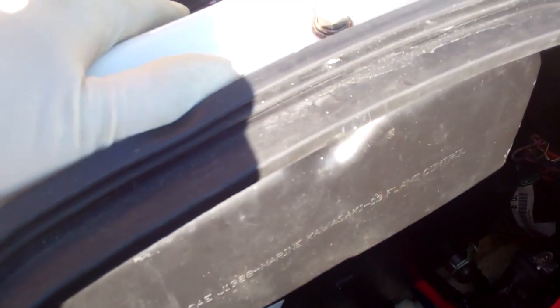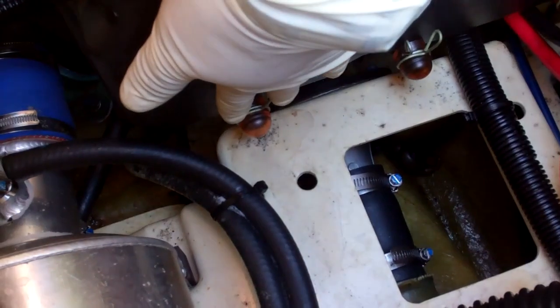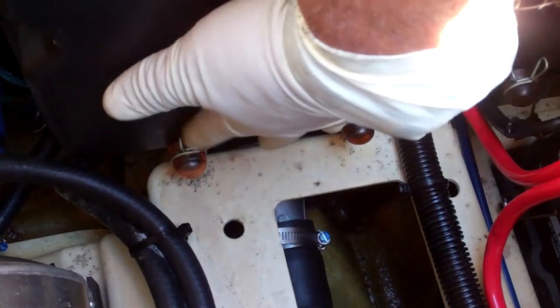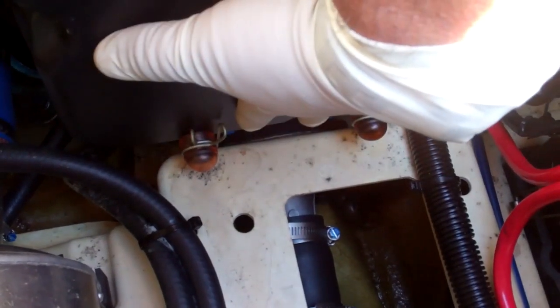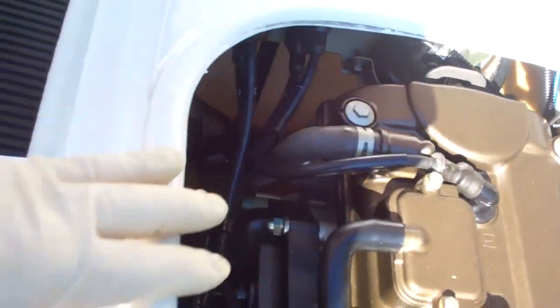Unless you've had some issues with it, mine was spotless. I don't think anybody's ever taken it out. There's nothing else in this box but the spark arrestor. Do check your little flood — I can't think of the name of them. There's three little rubber things here that if you happen to get water inside of it, it'll let you know so you can see it. Just make sure they're on there good. Again, check all your hoses, check your fuel hoses here and any hose you see with a hose clamp — check it.